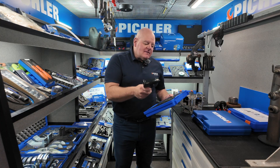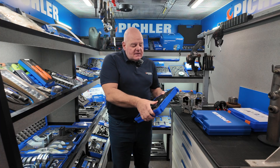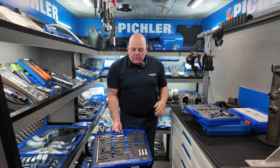So that's the vibration gun for glow plugs. It gives you the chance to try and remove them. If they're more stubborn and won't come out, you can go back to your customer and report that if you go any further you may end up snapping the glow plug, which would lead to a whole different cost to the repair.